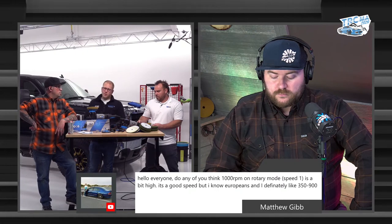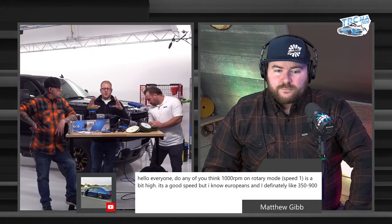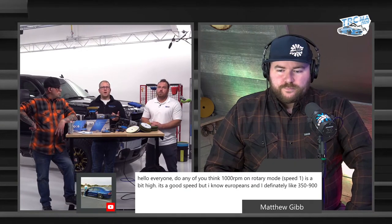Right. So you have a full-bodied tool that's got a completely different makeup in terms of its structure, and it's operating a 7-inch to 8-inch pad down to 600 RPM, something like that. If you look at a Flex P14, that tool is going to drop down to like 900 RPM. So realistically, we're right in the same ballpark of that. Because our tool only comes with a 5-inch backing plate and currently is not interchangeable, we feel like 1,000 RPMs is actually kind of a sweet spot.